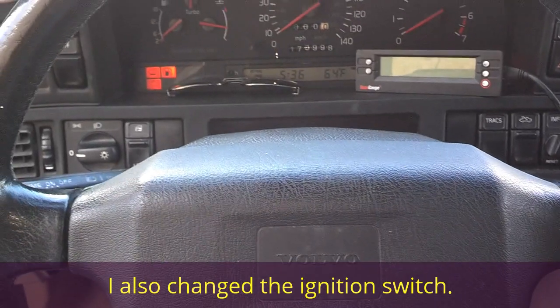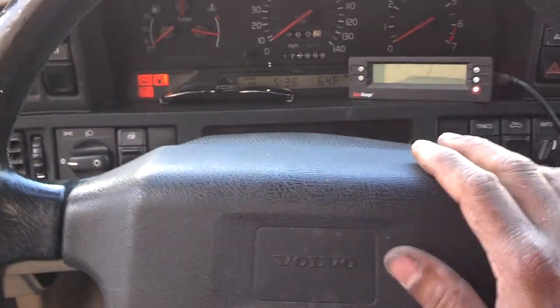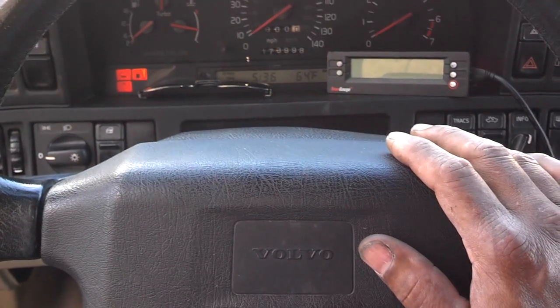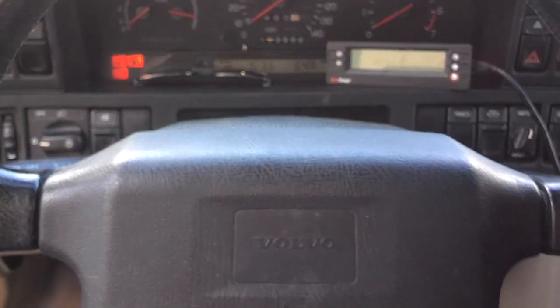If you don't put this steering wheel in right, tightening the right side down first, this airbag pad, you can damage the horn, and you got to have that reel pinned in so that don't come unraveled. So this is the big test to see if I put it in right. If the horn works, I'm good. If the horn doesn't work, I'm bad.